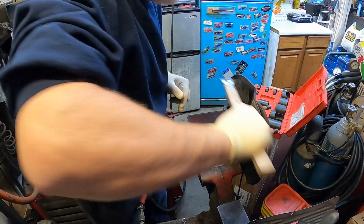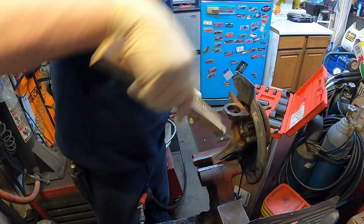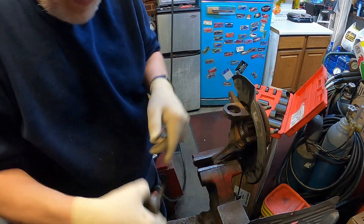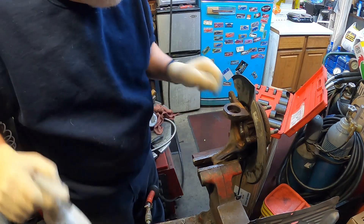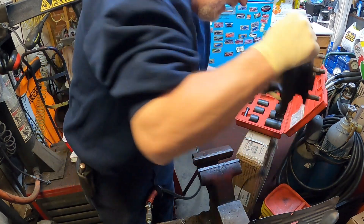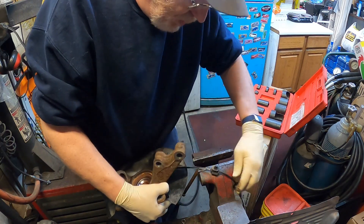I have my wire brush - I like the wire brush. The new ball joint will have a clip that goes up around here to help keep it in, but you don't really need it. After I kind of clean it up, I put a little WD-40 in there. Let me reposition this in the clamp to make it easier to put the new ball joint in.